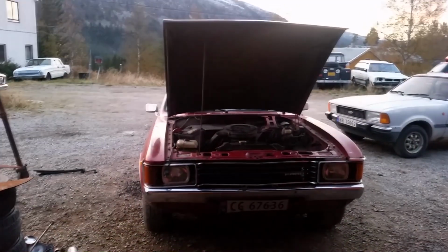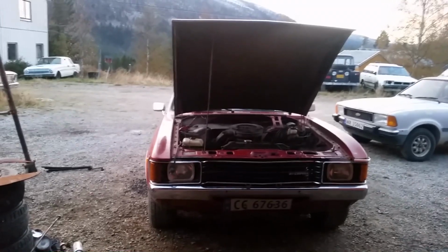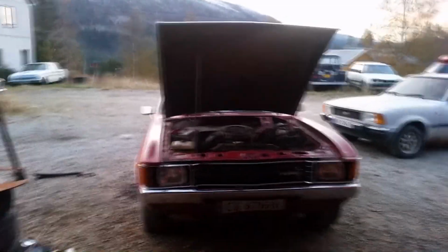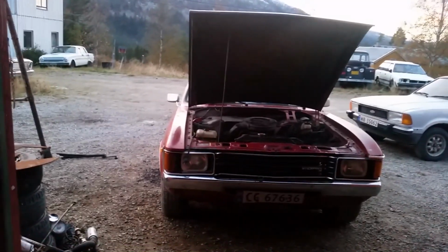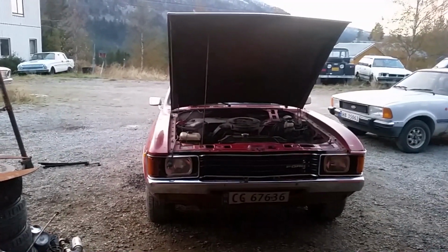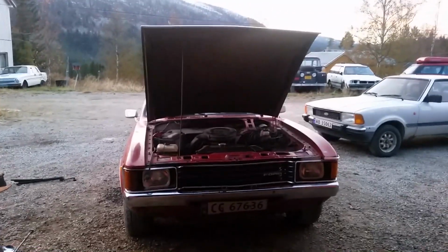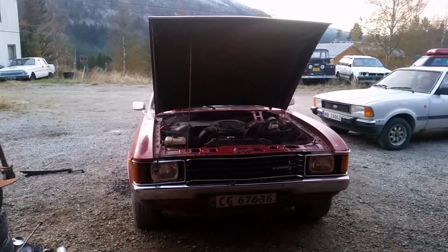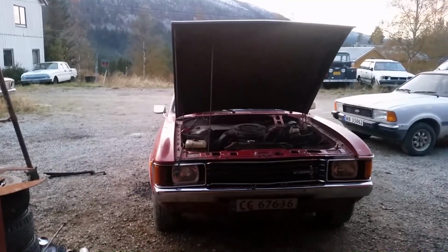And then I'm going to have to start looking at some winter tires. Those are mud and snow tires. There's not a stud in them, which I don't like. I prefer to have some proper studded winter tires. With an old car like this, rear wheel drive, it's going to let go, and with just rubber, no studs, it's going to spin like crazy. And it spins enough as it is with studs in it. So we'll get around to that later. But for now, this is just fine. Time to clean up some tools and get the toolbox and stuff back into the car where I usually keep it. So that right there was 2 days ago.